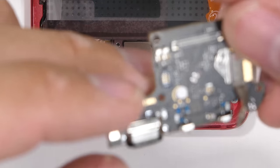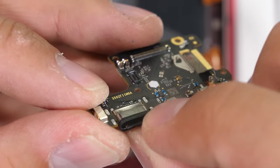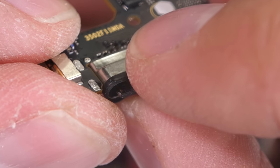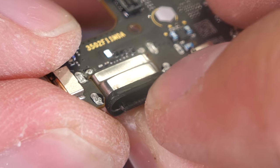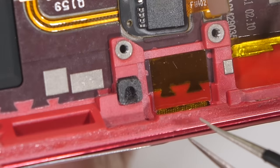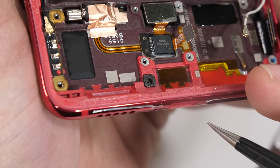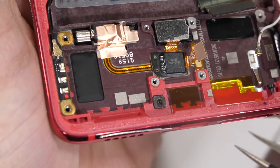The charging port board shows us its 27 watt quick charge capable USB-C port with a white hexagon shaped water damage indicator. There is rubber around the tip of the port. And if we look closely we can see another tiny water-resistant screen inside the phone over the microphone hole. It's hard to call this phone totally water resistant since it has so many large openings, but it does have a lot of protections against water, and that's always a good thing.